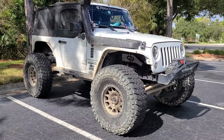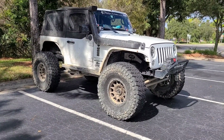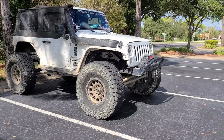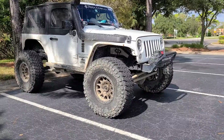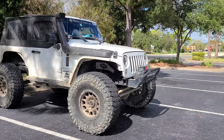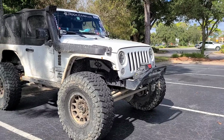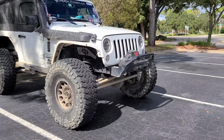So pretty much things I would do differently: wear items, replace them immediately. Just don't be cheap. Just replace all your wear items. They will go eventually. I ended up replacing all the calipers pretty much one by one, and it was incredibly annoying because they all seized within 3 weeks of each other. Ball joints all failed. Unit bearings, one failed, and I just replaced both. But yeah, pretty much all the wear items are new now, and I finished this swap in July.